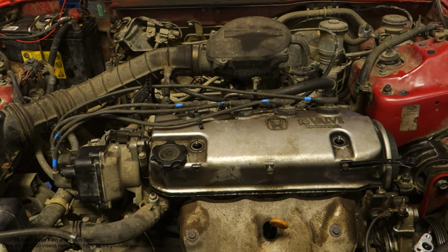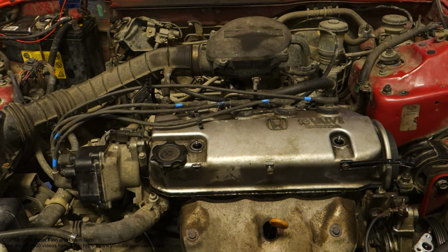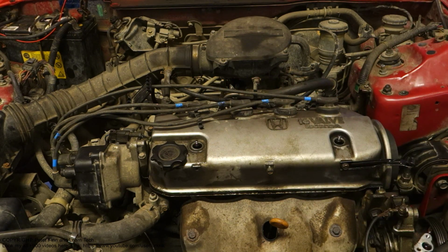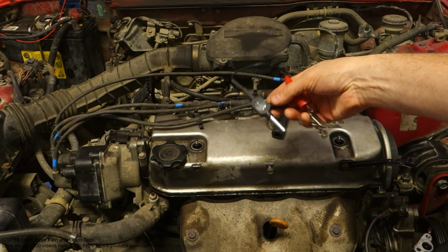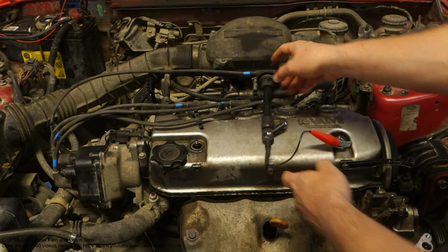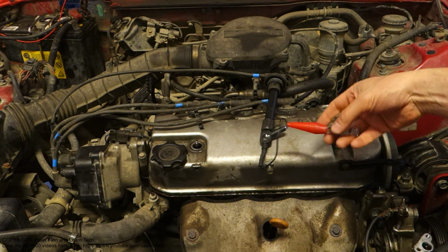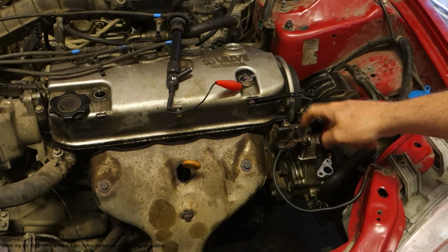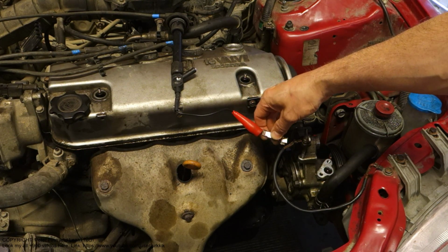Okay, then we start the testing. When we have these spark plugs in these holes, I first need to take the spark plug cap away, and here is my tester. When I insert the tester inside, it goes in nicely. It is fine, and then I need to connect the other part to minus, like earth. Earth is normally the car body, and there is this black earth cable, and I need to connect that in this position.